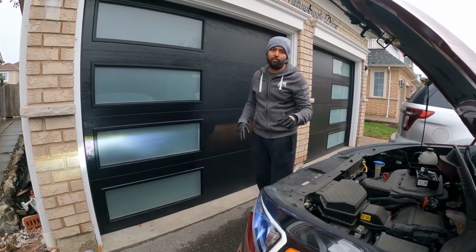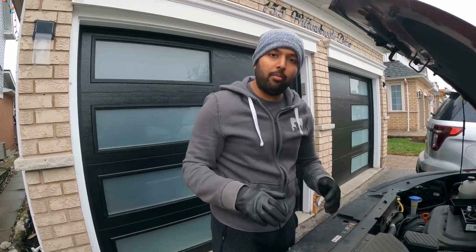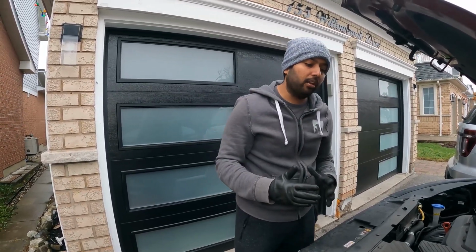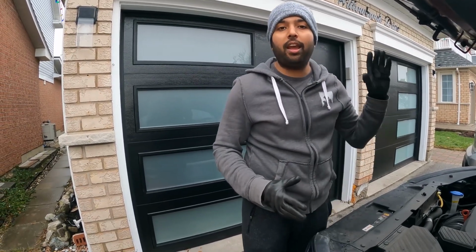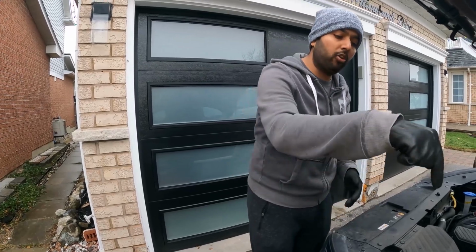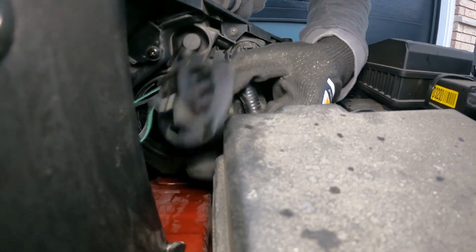I'm going to seal the light, that way none of the dust or anything goes inside. To put the extra cable inside, what other people do is they remove the original bracket from the cable and try to connect the LED with some tape or something. But instead of that, I'm going to keep the whole assembly inside instead of removing the original bracket. That way, if this LED fails, we still have our original halogen bulb, which we can use right away. If it fails on the road, we have an option available. So let me show you. I'm going to put it inside and close the headlight. As you can see, this is the whole assembly. I'm just going to slide this thing inside.